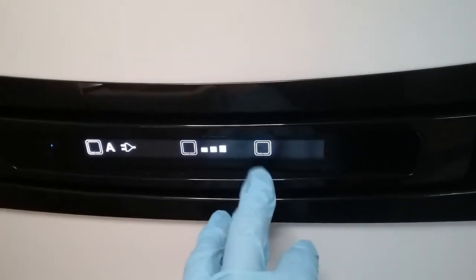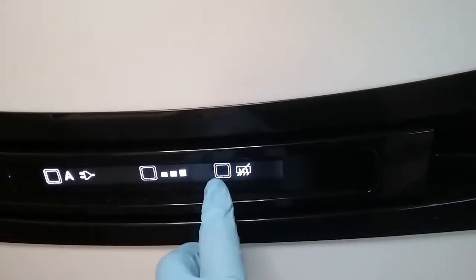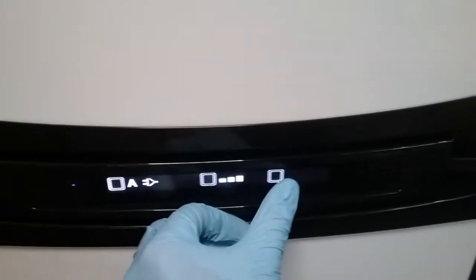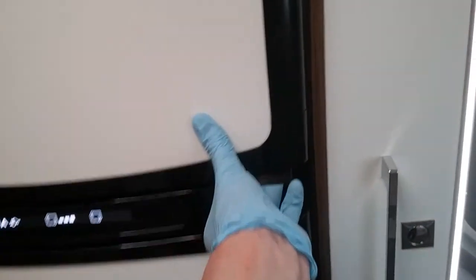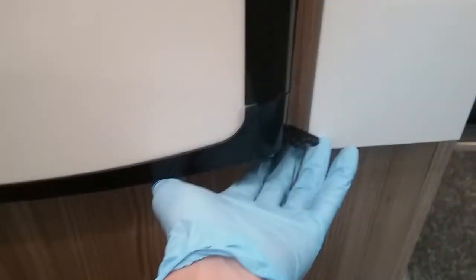Temperature control is just here. The last button is the unit's anti-condensation jacket — currently on. The jacket definitely needs to be on in the hotter summer months as it stops a build-up of condensation behind the unit which would run down and form a puddle underneath it; it can be turned off in the cooler months. We have the freezer box at the top, the fridge underneath, and because it is a very large fridge it does have a secondary travel catch at the bottom.